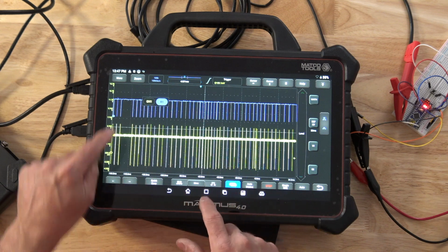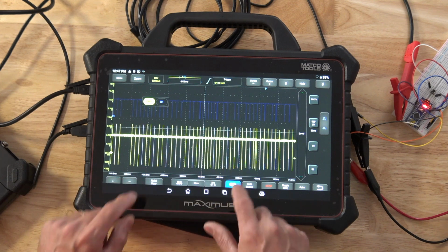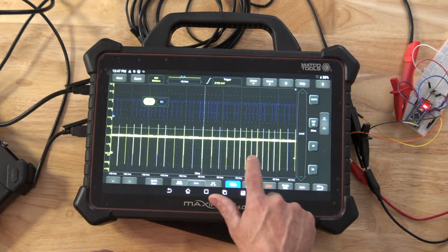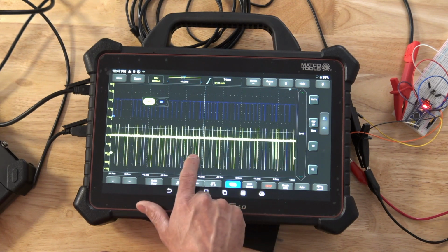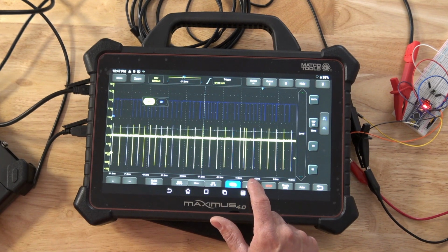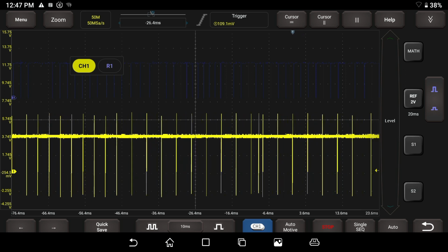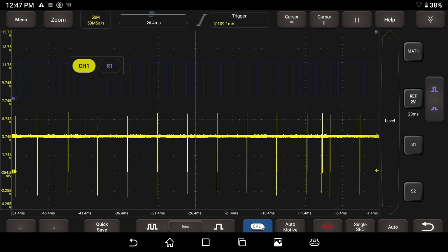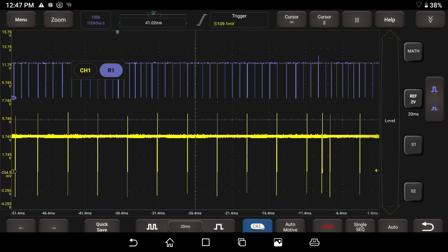So if we go back and select our channel, we're going to go to channel 1. I'm going to make this a little bit bigger so we can see it as we scroll through here. There's a hiccup. I put an extra tooth in there, just one extra tooth. I know that's kind of cheating and mean, but this is real life. This is actually a scenario that I found. If you haven't seen it, be sure to check out that Mercedes-Benz crankshaft video on YouTube. But if we click on our other channel, R1, we do not have that extra tooth there.